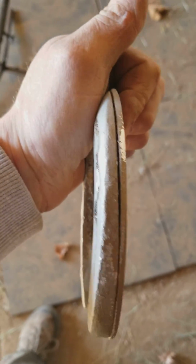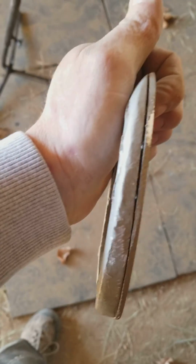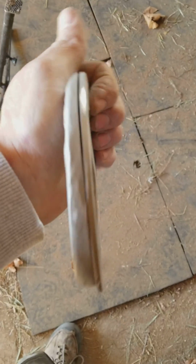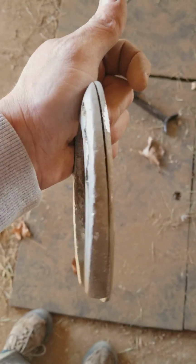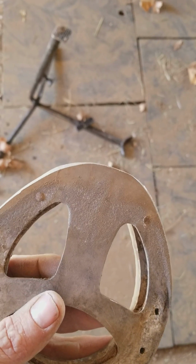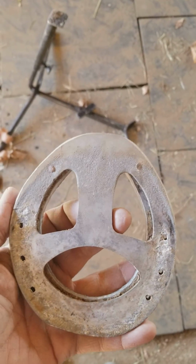And you can see this shoe has a gap, but that gap is from the way it's kind of sprung because of the rivets. And when I nail these on, that gap will close back up and won't be so sprung. And if I'm having trouble with it, to be honest, it's real easy to knock those pins out, clean it up, and remount it if I'm that concerned about it. But these things work a treat.